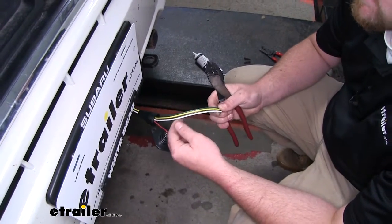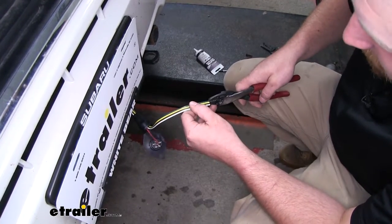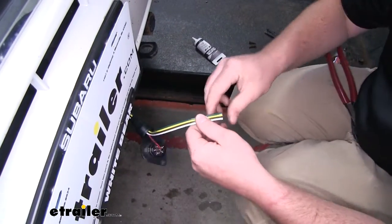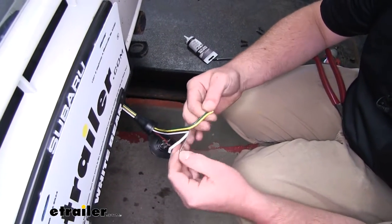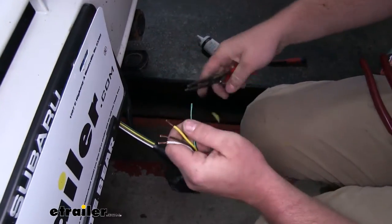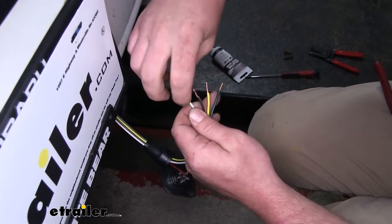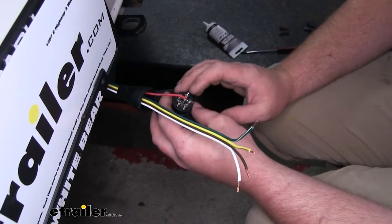Now what we're going to do is connect our wires to our six-way. We'll first start by separating the wires from each other — cut a small split in between them and peel them back, separate them an inch or two, then strip back some of the insulation to expose the bare wire underneath. Twist them to get them tight.